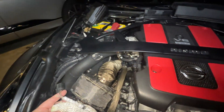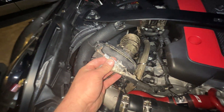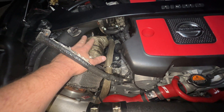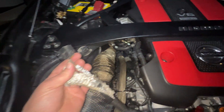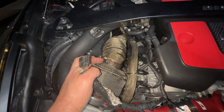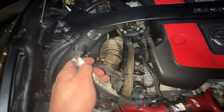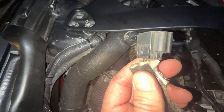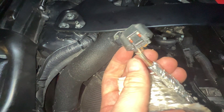I've discovered why my fuse has blown on the engine control. My MAF sensor cable comes across here, over this hot area obviously on the turbo. I've tried to heat wrap it really well — both the turbo exhaust piping and the actual cable — but just this area was exposed and you can see it's just gotten hot and brittle and snapped.